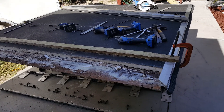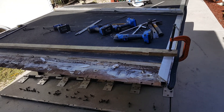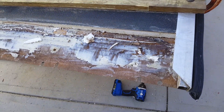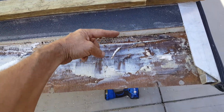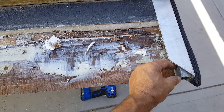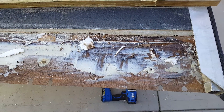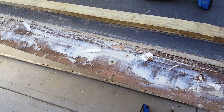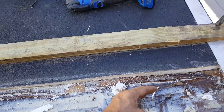Hey YouTube, I'm posting a video on my toy hauler. The back gate door has been cracking at the very bottom for quite some time and I decided to get in there and see if I could fix it. I'm notching out the bottom — there were two aluminum square tubes that went across the bottom and they only had one weld on each one, so eventually it fails. Welcome to cheap built crap, but I'm going to modify it and hopefully fix it.